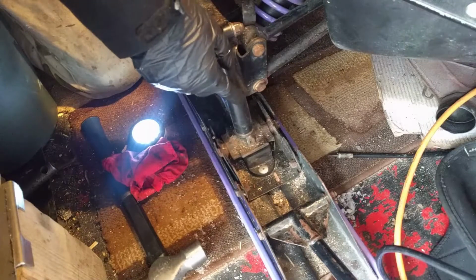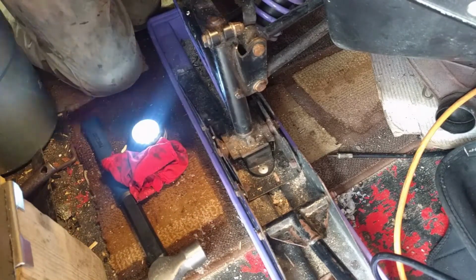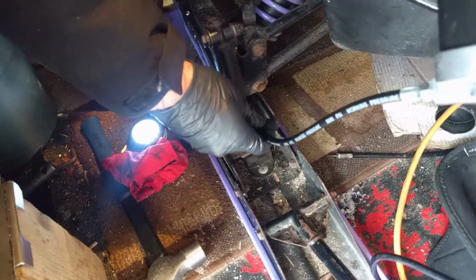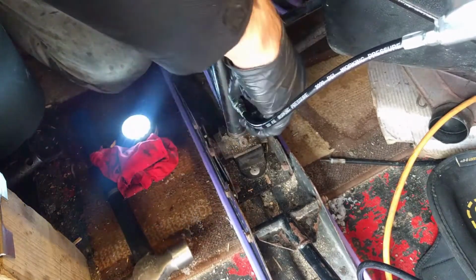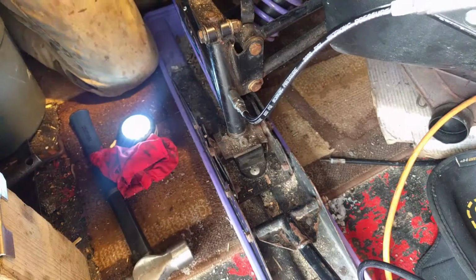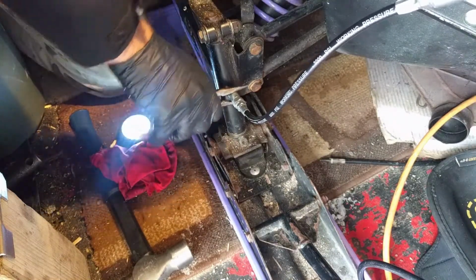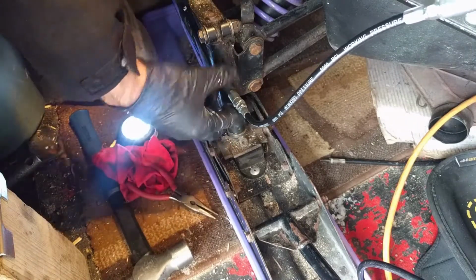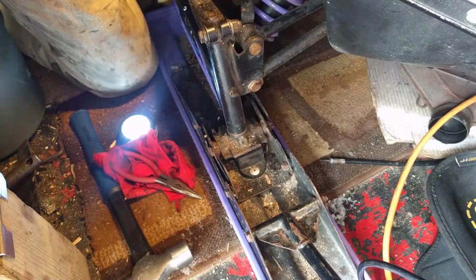Alright, next up, going down to our ski. Don't know the name for this, but that's how you can find it. I would say if you don't see grease coming out and you've given it like 7 good pumps, that's probably good. Definitely don't want to overdo it because you could blow a seal or something. Handy way to get these off when your fingers are greased up is just take some pliers. Same thing on the other side, on the other ski.